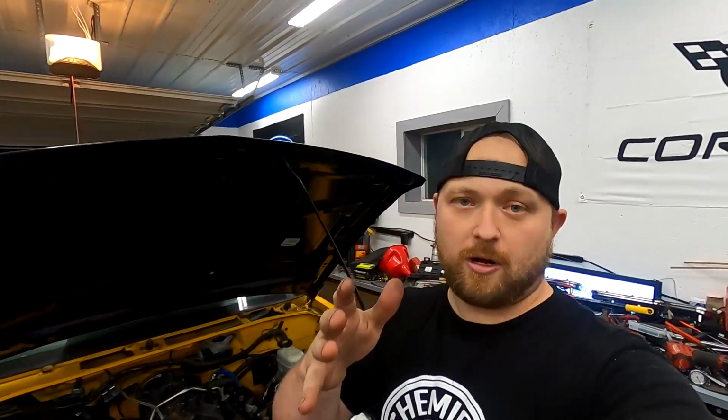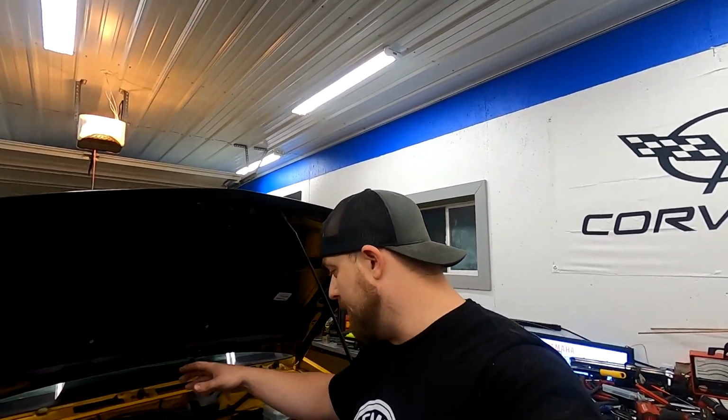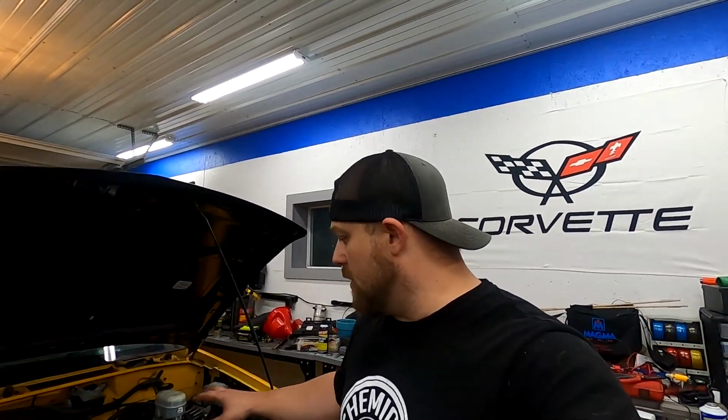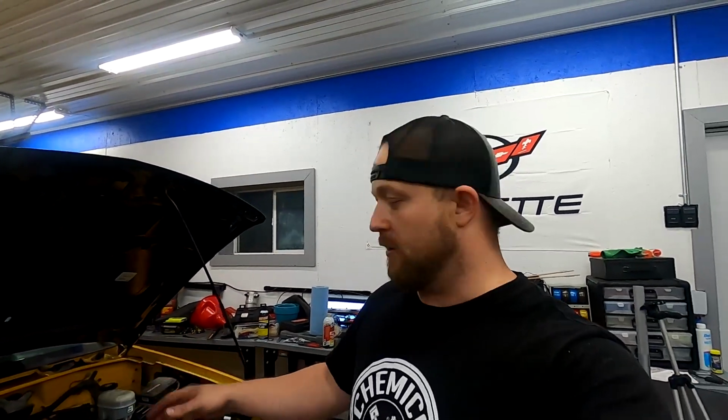So I know this was a very long episode, but we got a lot done. Obviously, I started the video with basically the engine tore all apart. We got the cam swapped. We got all the factory stuff put back on: intake, fuel rails, coil packs, valve covers. I replaced even the rockers with factory rockers because I want to take the nice trunnion upgraded rockers for the Nova build. We got the ICT Billet accessory brackets put on. Those are really nice. Instructions kind of suck, but if you're doing this, you can figure it out.